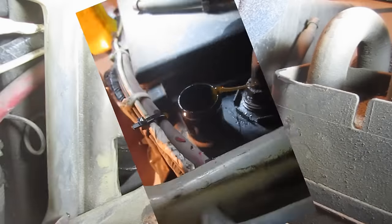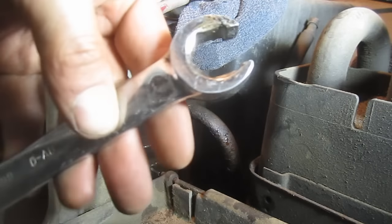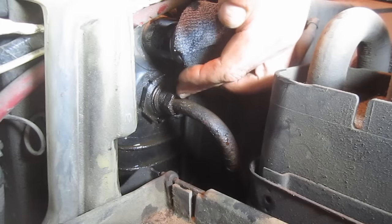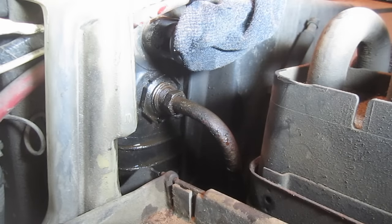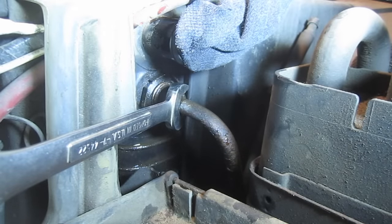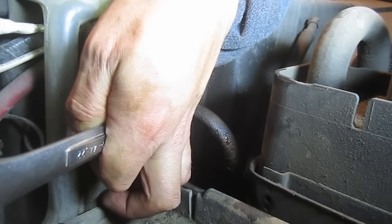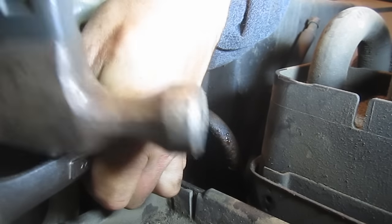Have your catch pan there, obviously. Ideally you'd want to use a tubing wrench — it's offset and has more grip compared to an open-end wrench. If I can't get this before I strip it out, I'll cut it off and use a socket since I have no need to save this. One reason I wouldn't want to cut it is because I don't want metal shavings in that cooler. So I'm going to take a 20mm open-end and just tap it — I sprayed it with PB Blaster early on. I'm going to keep my hand against it so I don't strip it, take a hammer, and apply pressure at the same time.